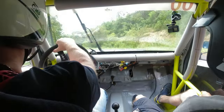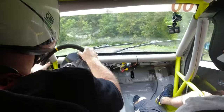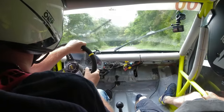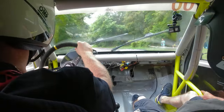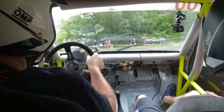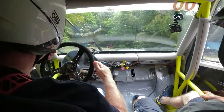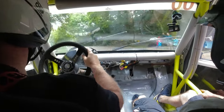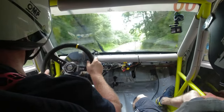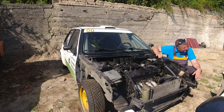Normally you check the belts. The guy said it had been serviced, so we took it out for a spin, for a race, obviously overchecking the car. We came to the race, did the first couple of laps, the battery was a little tad down, and the car wouldn't start. I thought, oh, bummer, we somehow ran out of battery. I checked the dashboard, there was no battery light, so I thought I should check the cables, probably either the bulb or the cable had been ripped off going uphill. So we checked it and we realized there is no alternator on the car.